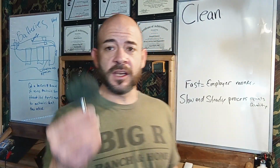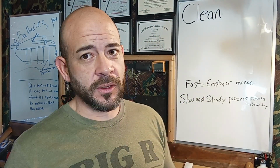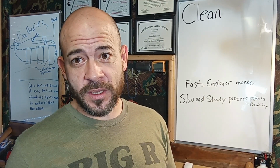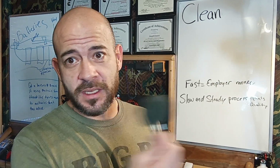So let's say I'm going to clean an injector bore, right? I get a Scotch-Brite, something like this. What should I do after? I should go in there and check all those oil galleys, because on some of those Huey systems, it'll foul up the next injector if I just push all the lint from this one to the next one.